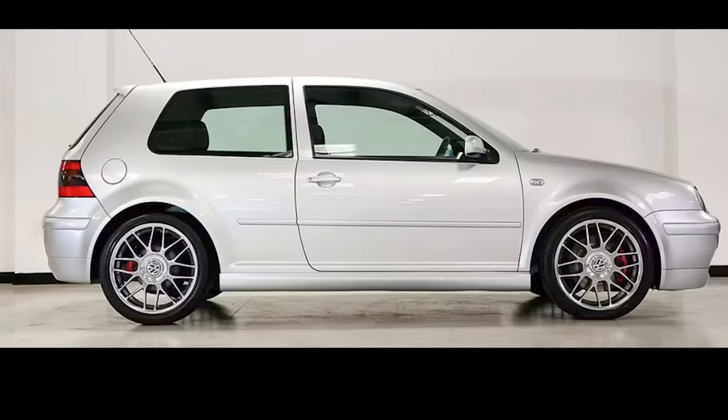I've got the split rims and I'm keeping them, so don't try to buy them. I wanted to look at lighter wheel options, and a set of BBS anniversary Mark 4 Golf wheels came up for sale. I know for a fact they are lightweight, which reduces the unsprung weight. The lighter your wheels, brakes, and everything before the shock absorber, the quicker your suspension will react because there's less weight being pushed about. Basically, lighter wheels improve handling and suspension rebound. So I now have different wheels — and like I said I'm keeping my splits because they'll probably end up back on this at some point — but I wanted to try lighter wheels with the new suspension.